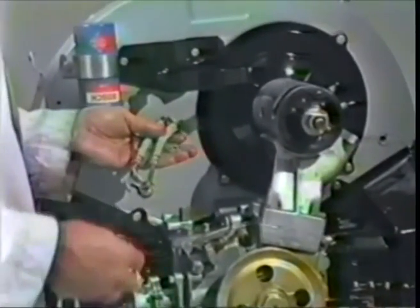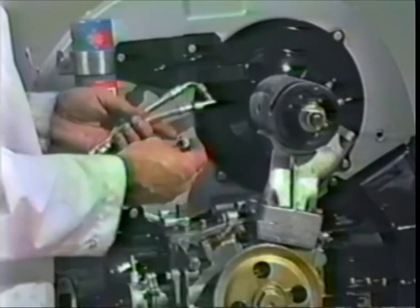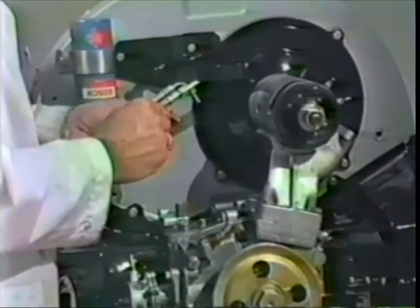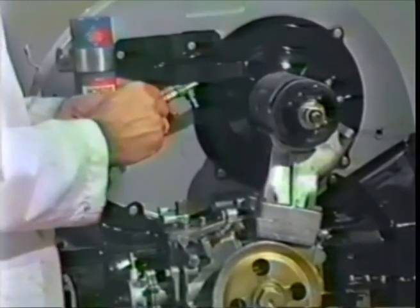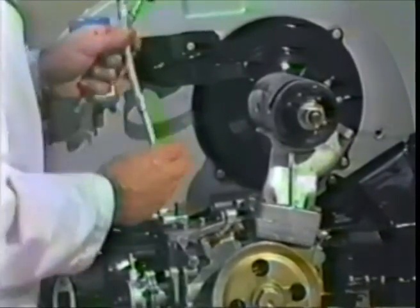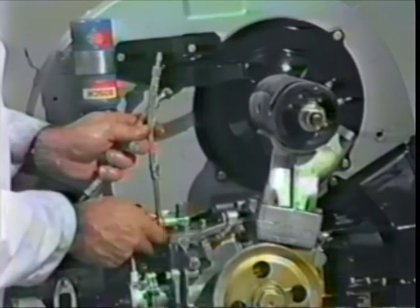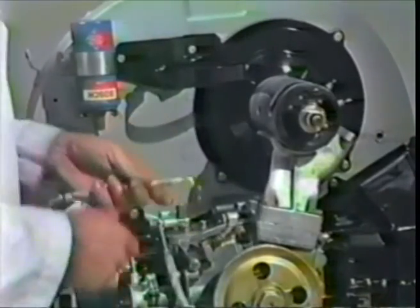Then we find a 12mm wrench and our brand new oil lines. And with the oil lines go a CAD-plated oil line attachment. And we take 2 aluminum washers that come in the lower end gasket kit, put one on the bolt. This bolt is hollow, got a hole through the middle, got a little oil outlet line there that is what regulates your oil flow to your oil filter can. Put that through the oil filter inlet line, put the other aluminum washer on, and tighten that down loosely. Leave that like so for the moment.